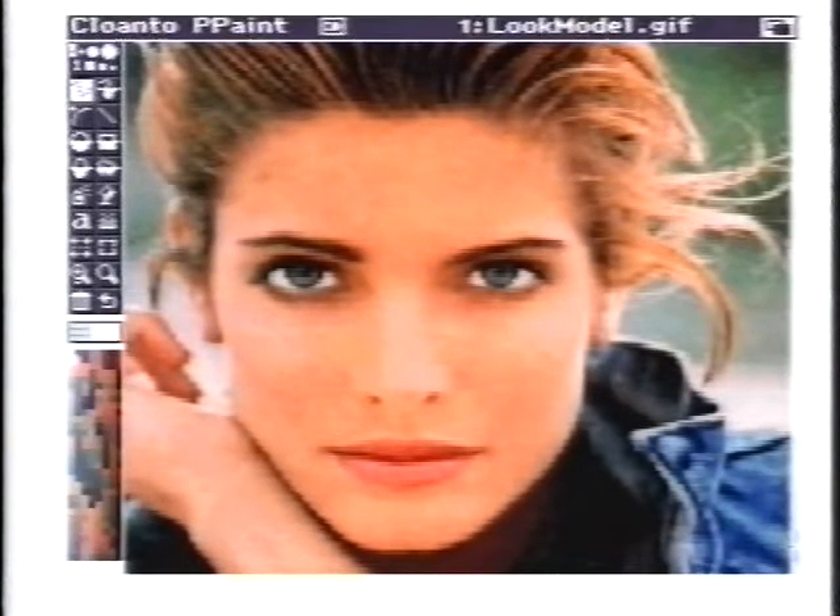That's a glimpse of specific video hardware for the Amiga. Let's now take a brief look at video digitizing. A digitizer is basically a gadget that takes one frame of a video signal and grabs it as a still, then turns it into digital form so that you can treat that frame like any other Amiga bitmap picture — loading it into a paint package or image processing program. It's mainly used for grabbing frames of your video and image processing them, but it can also be used for doing traditional animation on paper, then digitizing it in and running it as an Amiga animation.